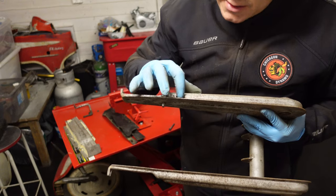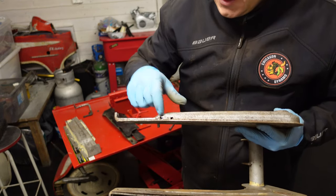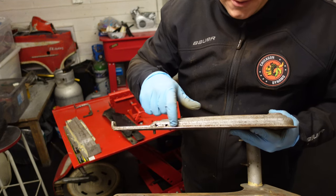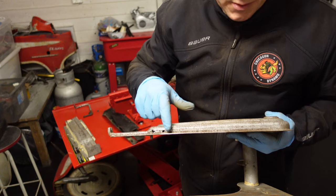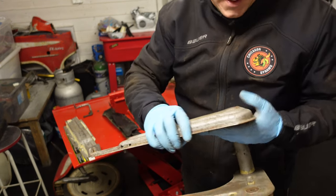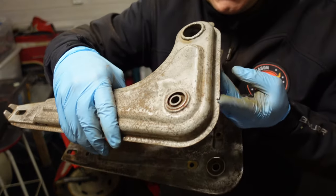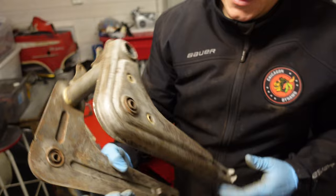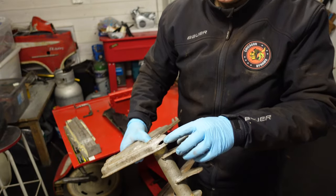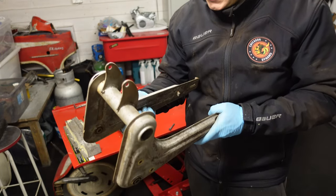I'm sure it has some better metal here, so it's only on the lower parts. The hollow cavity ends up here, so it's the bottom part of the place where the water has been sitting. So I will cut a small piece out from there and make a patch. I will also fill in this small dent here, and of course fill the bigger hole up here so we are not having the same problem in a couple of years again.